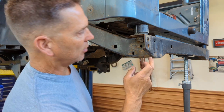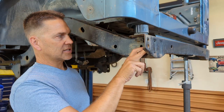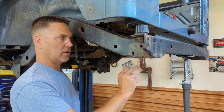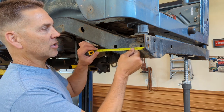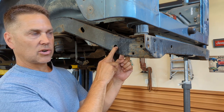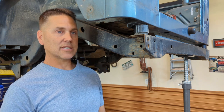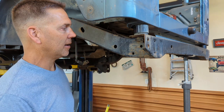This hole is consistent not just in position but in its relationship to the rear cross member. On the rear cross member you have these dimples — you want to make sure you're measuring from the inside of the dimple consistently on all four points. Measuring from that reference hole, I get exactly seven and a half inches on the inside rail, and exactly seven and a half on the outside rail, and the same on my other Jeep — giving me an excellent frame of reference for where to cut.